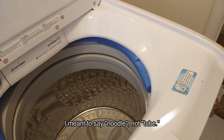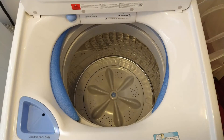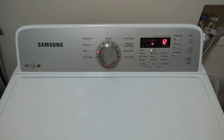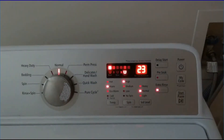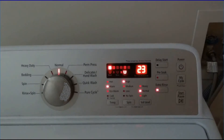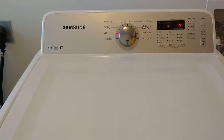The $1 swim tube helps prevent the washer drum from vertically bouncing too much. The other problem I ran into is that when I had heavy wash loads, such as washing several bath towels at a time, the spin cycle wouldn't complete because the horizontal and lateral load imbalance would stop the spin cycle and kick it back into rinse cycle. Going into the spin cycle, the washer would be at the 16-minute remaining mark, but then kick the timer back up to 23 minutes and restart the rinse cycle.